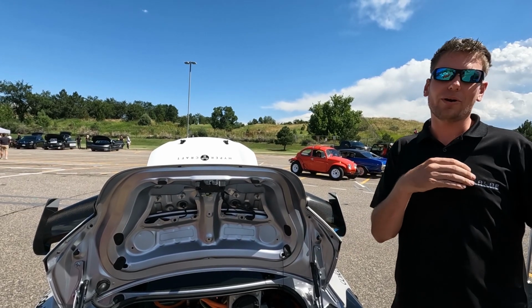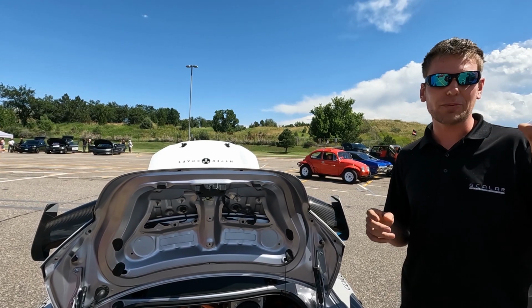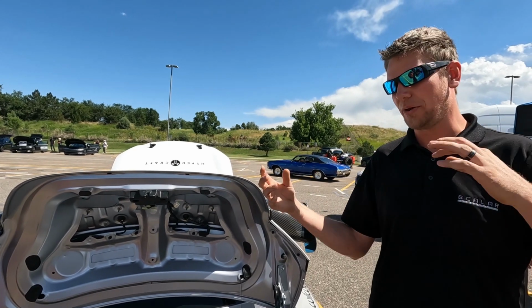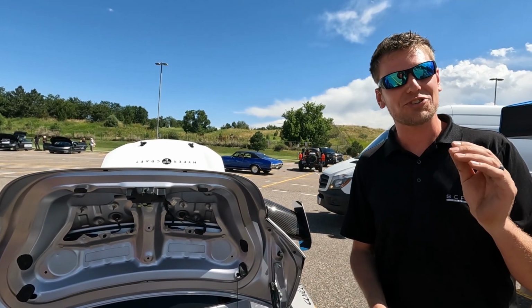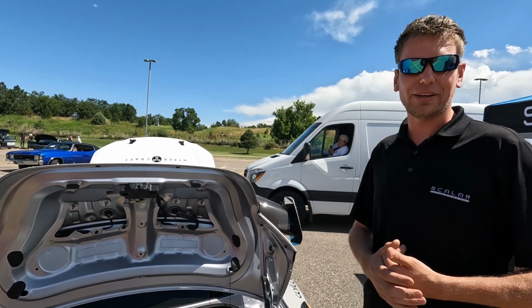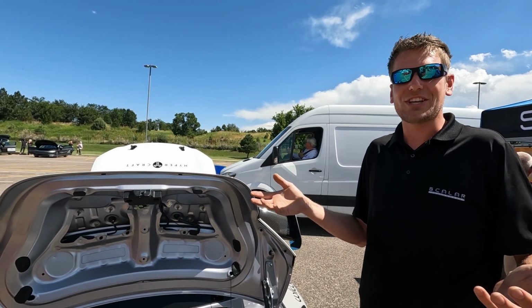So what is that top part of the battery worth as far as how long it lasts throughout the race? That top 30% is worth more than the bottom 30%. Yeah. So do we go out with a higher charge and run big brakes, or do we run no brakes, slightly less charge, and then full regen? Again, these are things we're learning this year in prototyping. So we're trying a bunch of different things. With EV, there are so many different things that you never even thought of.